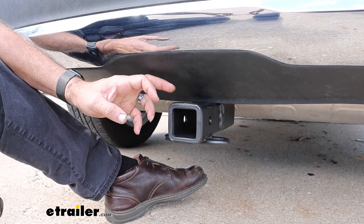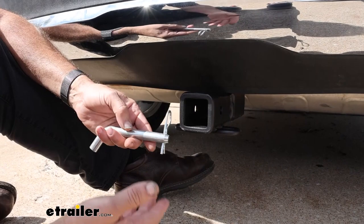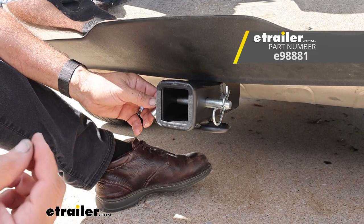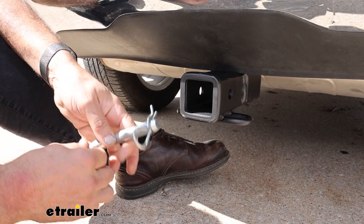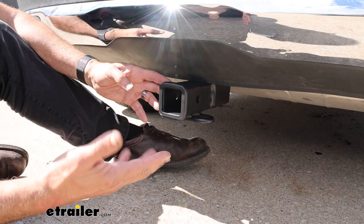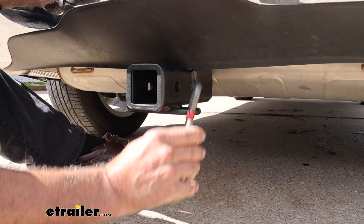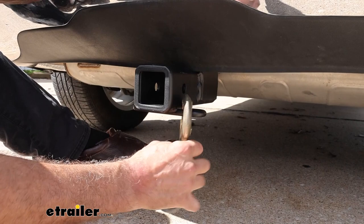That's something that I like. Keep in mind when you buy this it's just going to be the hitch by itself, so if you're new to towing you're going to have to pick up a pin and clip. This one takes a 5/8 inch pin and clip — we have these available here at E-Trailer. We also have locking styles if you're looking for more security. If you're in the market for cargo racks and bike racks, a lot of those accessories already include a pin and clip or an anti-rattle device, so just keep that in mind. This has a wire loop type chain hanger and there's plenty of room for your standard S-hook style or even a heavy-duty clevis style — it fits in here nicely.